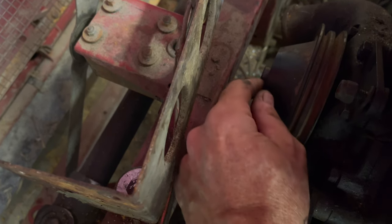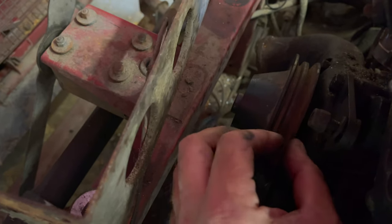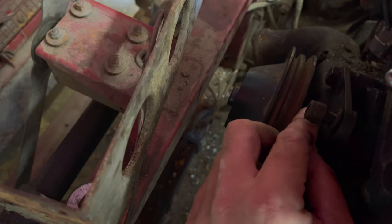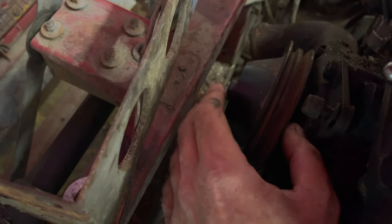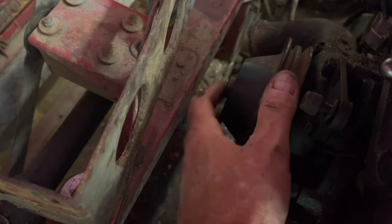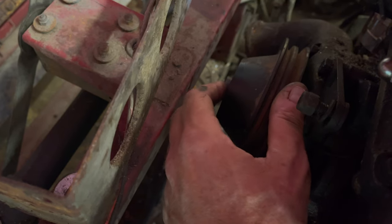There's like a little mount ring underneath here. And so I got a pry bar and some towels, and I was just ever so gently pushing on it because I see so many of these where this edge is broken and cracked. So then I thought, all right, let me spray some penetrant on here. I've got some real nice penetrant called Aerokroil. And I sprayed that here right on this little hub to try to push it.